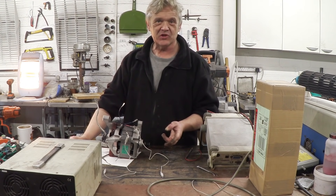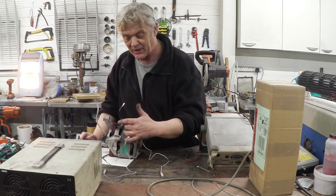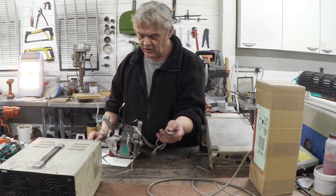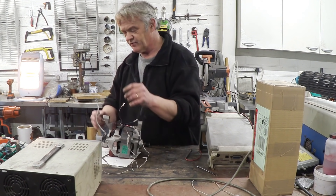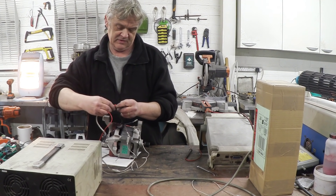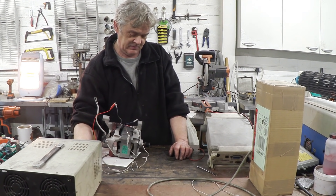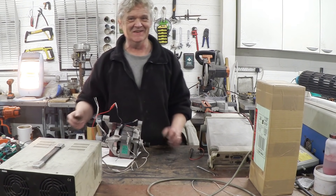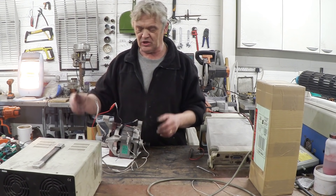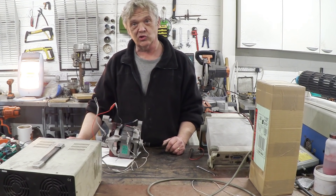So we've identified the coils we're interested in. There are only four wires needed: two wires going to the brushes and the two ends of the field coils, which in our case are the brown and the red. If I take one end of the field coil and connect it to the negative, connect the other end to one of the brushes, and then from the other brush connect it to the positive, and give it some DC voltage — sure enough the motor spins, because we've wired it in what's called DC series. The armature and field coils are in series, giving us constant rotation.